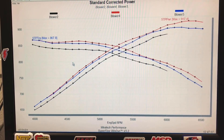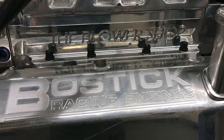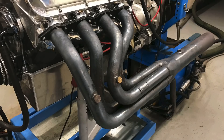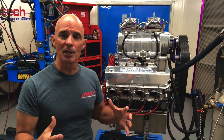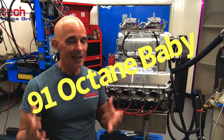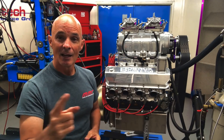After this was cured, this thing is ready to install in a boat and go make some noise. What did we learn from this adventure running this blown big block from Bosstic Racing Engines? Blown big blocks — lots of displacement, big blower, boost-referenced carburetors, intercooler, low compression — all combined to allow a combination to make over 900 horsepower easily on pump gas. That's why big blocks are so awesome. Make sure to like, share, subscribe, ring the bell — do all that stuff. I'll keep testing.